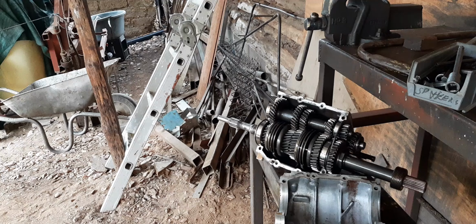And it's about the gearbox. I stripped this BA 7 4-speed gearbox. Now, it's a bit worn, this casing here. As you can see here, the oil is going to leak out from here. And so it did. No oil was in this gearbox, that's why I opened it. But there's nothing wrong with the gearbox inside.